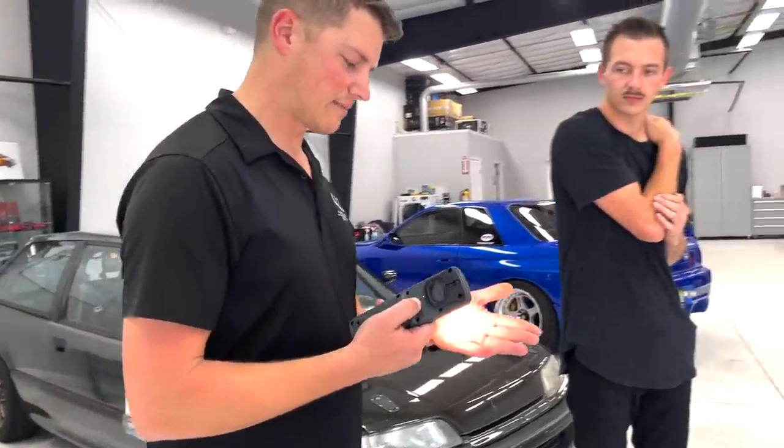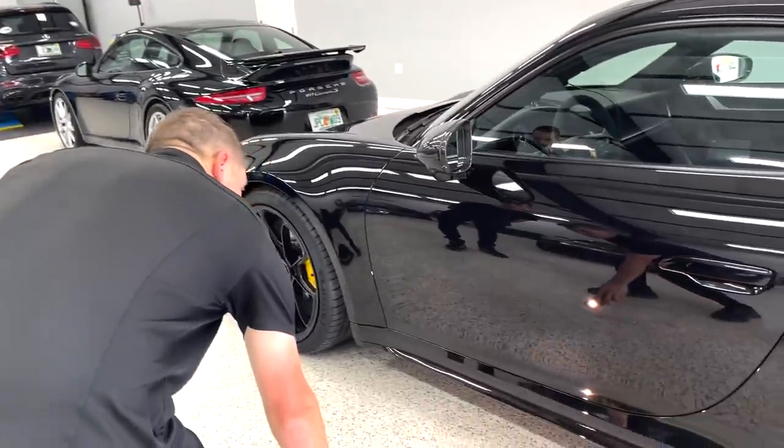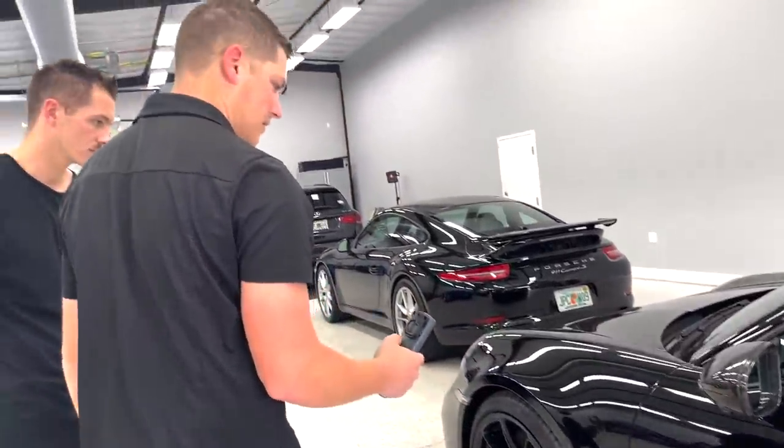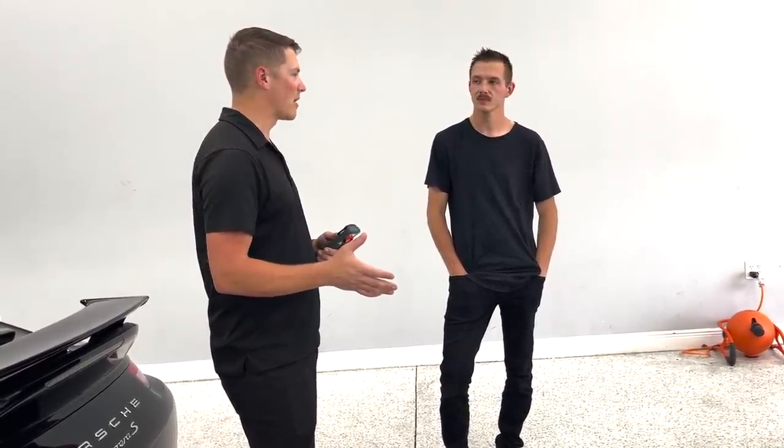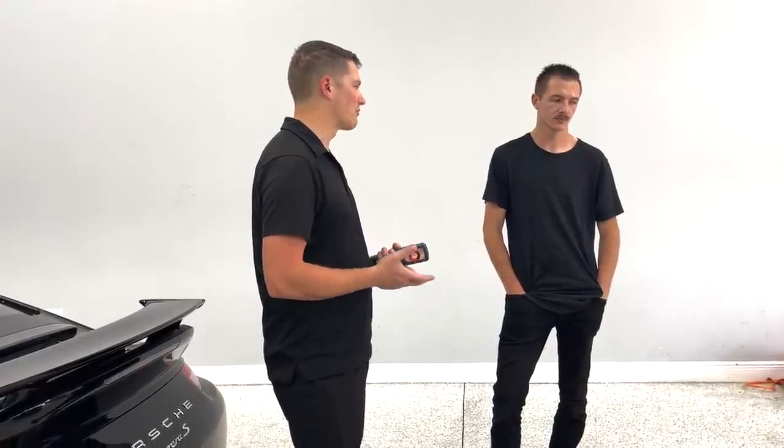This light will show us any issues that might have happened even at the factory or the port. Overall the paint looks pretty good, which is pretty typical for Porsche — their paint is usually pretty good. For the headlights, I know before we were torn on doing it because once you put PPF on sometimes it doesn't come off, but I still say put it on because if you don't, your headlights are going to get destroyed. If it does happen to pull the laminate when you take them off, you can still sand them down, clear them, and you don't have to buy whole new headlights. On the polishing side of things, we don't go super crazy when we're doing a full car PPF. Anytime you're polishing you're removing paint, and the clear bra will make it look perfect even if it has little blemishes like swirling — it kind of acts like another clear coat. But on a black car I still want to polish a little bit just to get that extra gloss and depth.